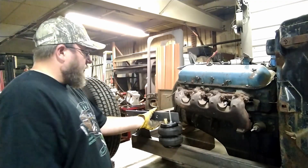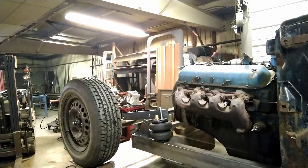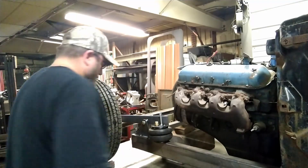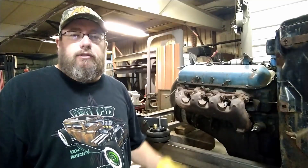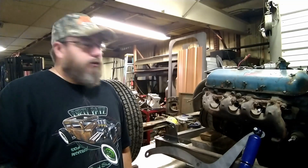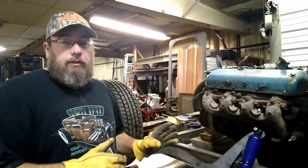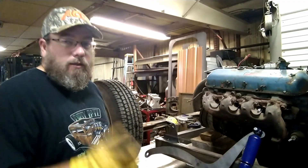So this is going to represent my arm for now. I've made a plate back here to mount to this little airbag that I've got. I need to actually check the stroke of this thing and see if it's going to give us enough lift to actually give us the right height that I want and still have a little bit of up travel as well. Long story short, I end up having to throw the front axle back down on the ground and get everything all measured out to make sure that everything was going to work as far as getting the right length of stroke out of this little bag to get us our right ride height. Everything's good, so I chucked that piece of metal and now I'm on to the next piece where I've tried to go ahead and mount up a shock. I'm getting ready to throw it on there right now and we'll see how that all looks.